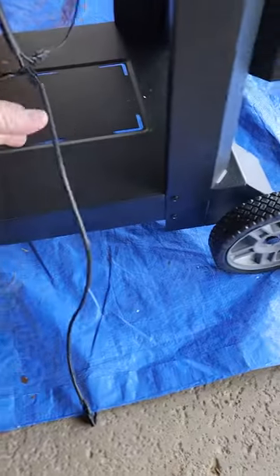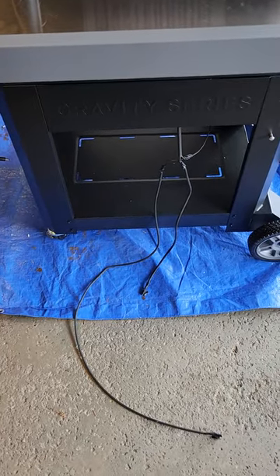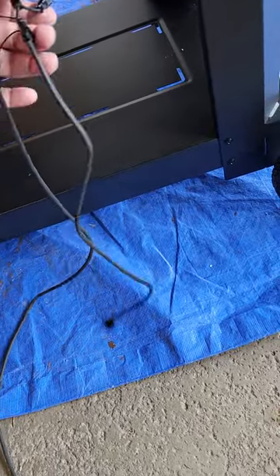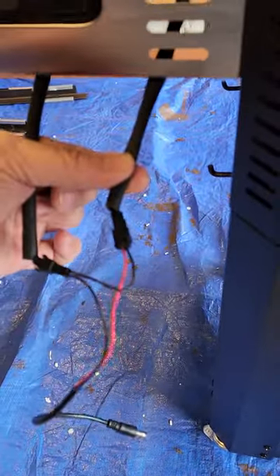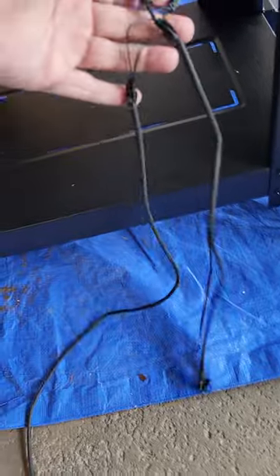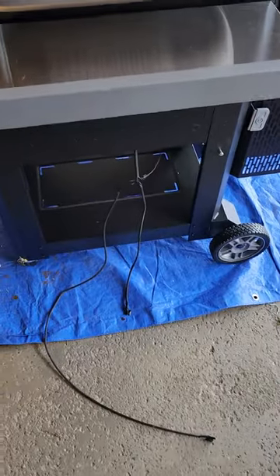By reason of deduction, something had to be wrong with one of these two sensor cables. The adapter takes those two sensor cables and condenses them down to one, because one cable is for the fan and one is for the door sensors. While it was hooked up, I unplugged the sensor cable that was good and plugged the other one in, and the fan immediately stopped running — confirmed there was something wrong with that cable.